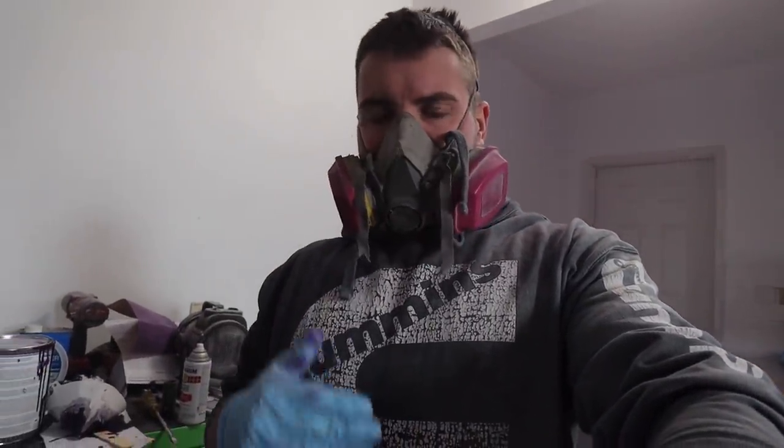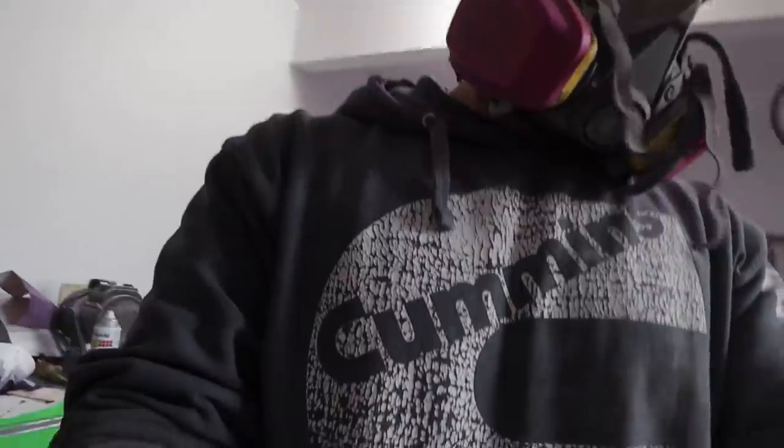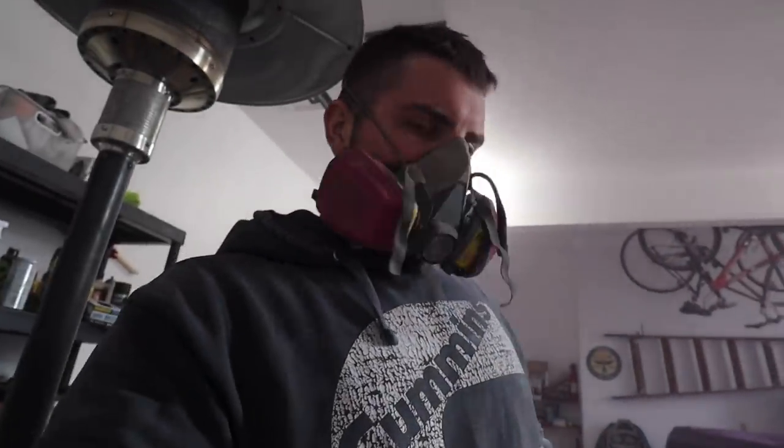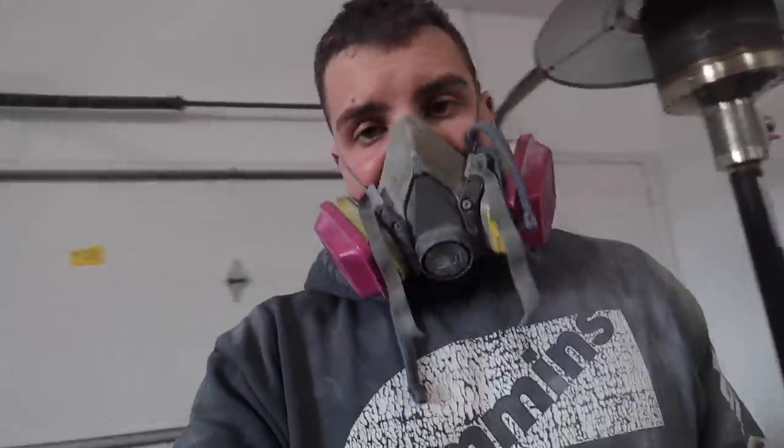I'm honestly about to take acetone and just wipe all the paint off and sand it, reprime it, and respray it. There's no excuse for me to not do that at this point. The rest of the bed is perfect. So I'm gonna acetone that whole panel and reprime it, respray it, and just do it the right way instead of trying to beat around it and sand parts and not do the rest. So I'm just gonna wipe it all off and start over, really.